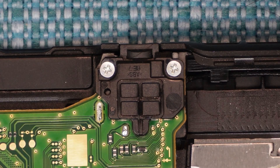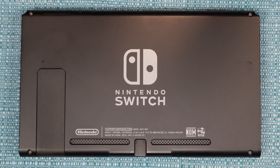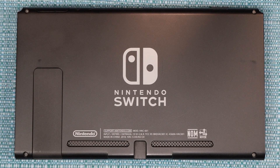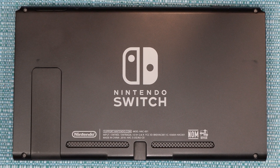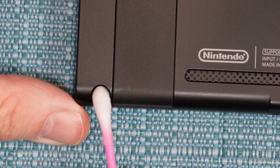There's going to be a lot of different screws in this process, so I suggest you get some type of screw organization into place before you even attempt to do this. The thing about the screws on this switch is that they are tiny and they are fragile, and they're easy to strip. It's imperative that they turn immediately as soon as you stick the screwdriver into them and start rotating.